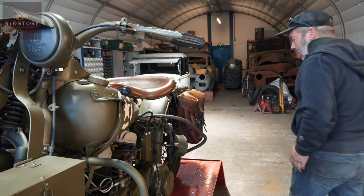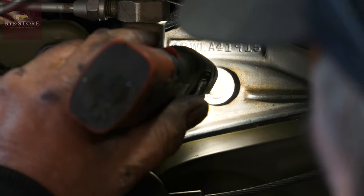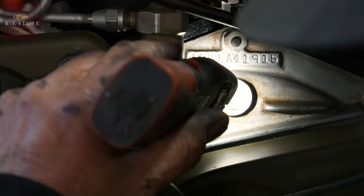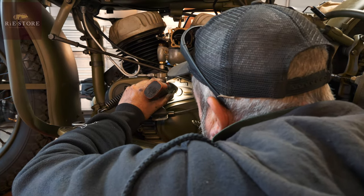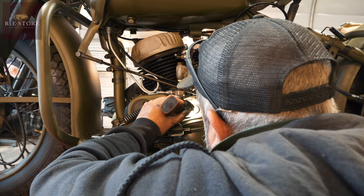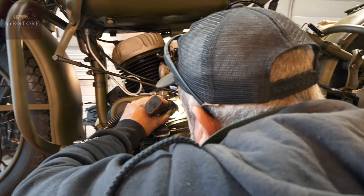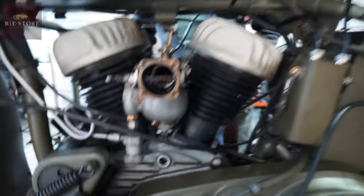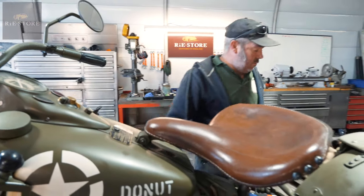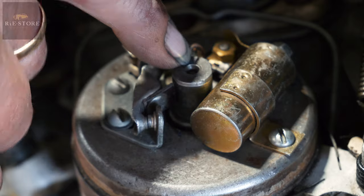Right, it's in top. I'll go backwards first. No timing mark there — it's got to be in here somewhere. There it is. Right, that's about the middle of the hole. So we want to come round another complete revolution. All the distributor's in completely wrong.